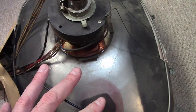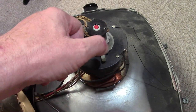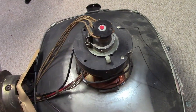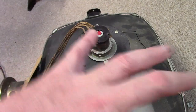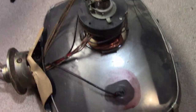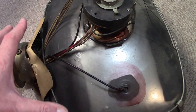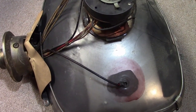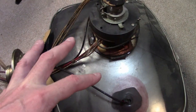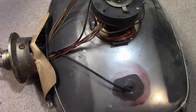If you do need to dispose of a dead picture tube, take this off and take some wire nippers and just clip the end of that off — it will let air in safely and it won't implode. However, still protect yourself: heavy gloves, safety goggles, put on a coat, cover all your exposed skin, face shield if you can. These can implode and glass will go flying if they do. Take care.